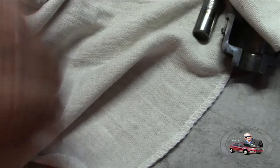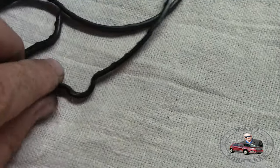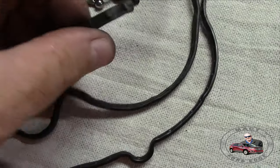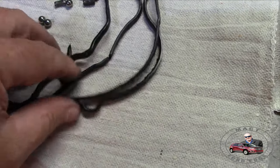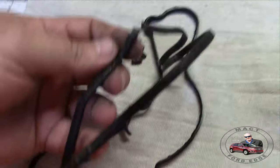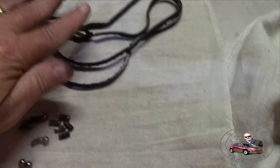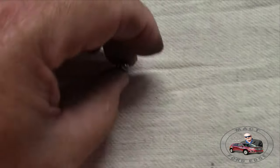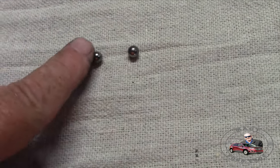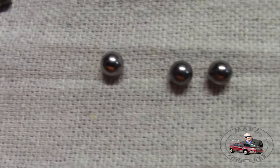So that can account for the silicon now, and let's check out some of the bearings. Now the gasket, you can see that the gasket isn't too terribly bad. I couldn't find any place that it was essentially bad, but you know, I cut it up myself, but I don't see anything that was really causing it. But again, this is a silicone gasket too, so who knows what that was doing. Now we have our ball bearings. Remarkably, the ball bearings, as you can see here, are not too terribly damaged.